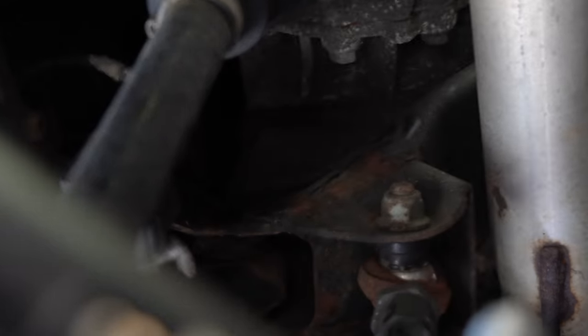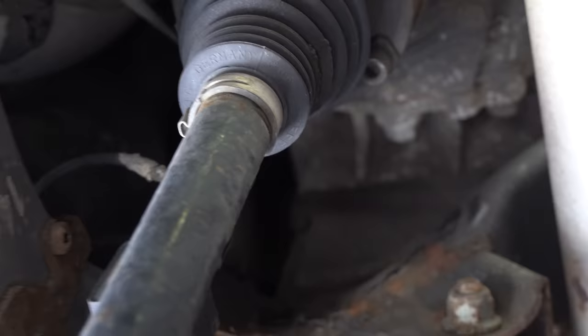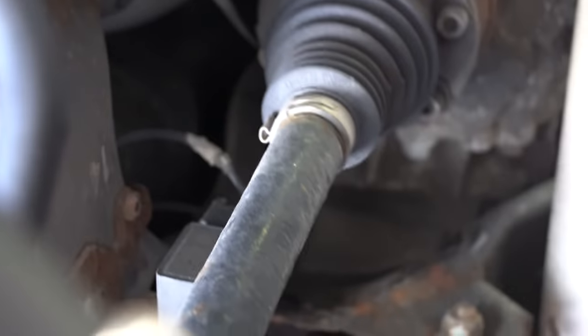If you have a Volkswagen, BMW, or an Audi, you always have that one friend who doesn't want to help you work on your car. If that bolt doesn't explain it - that bolt right there is hitting the subframe bolt. That subframe bolt is actually in the way of taking out that control arm bolt. You can't just slide the bolt out - you've got to take the whole subframe bolt out.